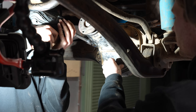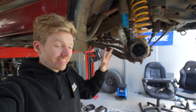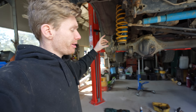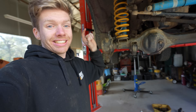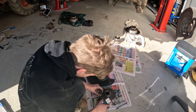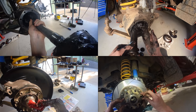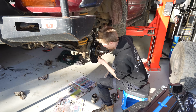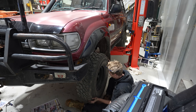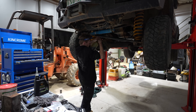And just like that, the 80 now had a front locker. With the air locker installed, we needed to rebuild the front end, then run our airlines back to the tank. The time-consuming part is cleaning - pulling off all those gaskets, cleaning all the surfaces, and putting it all back together is a lot of work. But since this was my third time pulling apart the front end, I'm getting pretty efficient and got it all back together in a couple of hours. Don't forget to fill your diff with oil - I'm using 85W-140 as the TGM manual specified, though 80W-90 is fine as well.